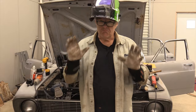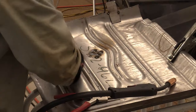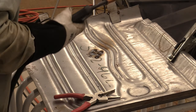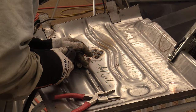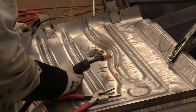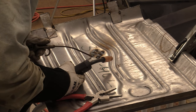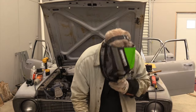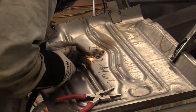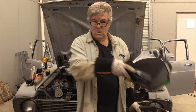Now if you really want to be right on top of it all, what you can do is go in on something like this weld here, throw your weld in, and cool it with air. That'll keep the heat down on the panel that you're working on. Again, this is a floor - not that big of a deal. There you go, that's now welded in and smoking. So that's ready to go from that aspect.